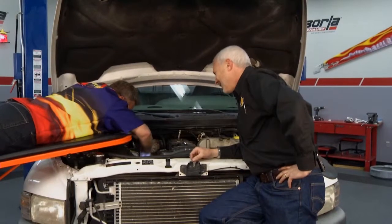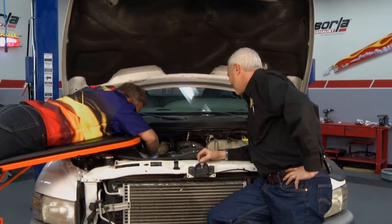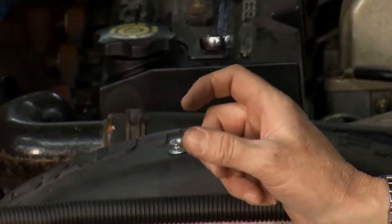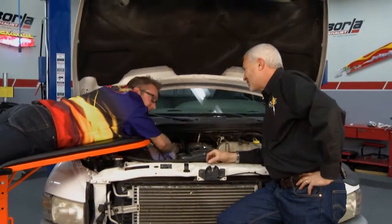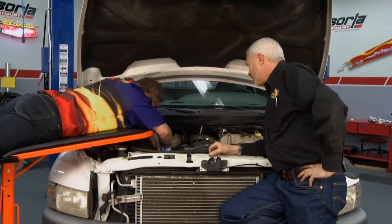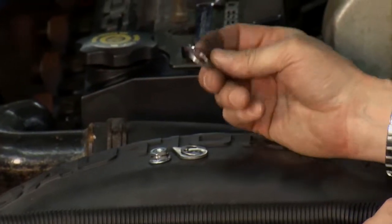This is some tight quarters to get in here. That's why you don't want to have to re-tighten them all the time. After header bolts, this is the second most likely bolt to come loose on a car. Five degrees of counter rotation costs you 50% of your clamp value — five degrees is just a little bit, almost impossible to tell visually. With a Stage 8 locking fastener, you can look at the retainer, and if it's still on the nut or bolt, you know for a fact it hasn't loosened.